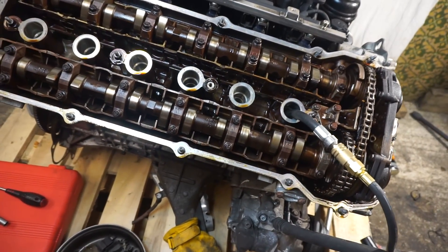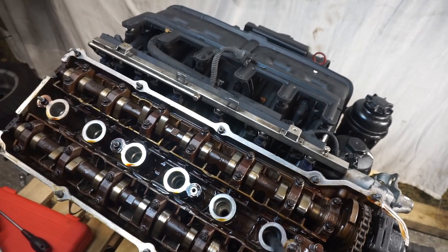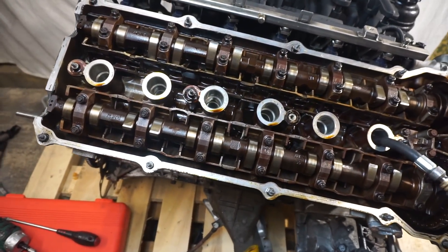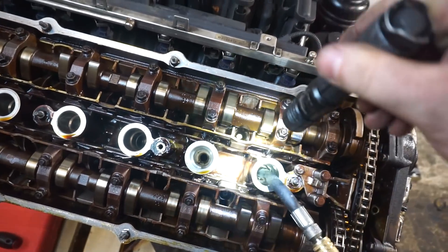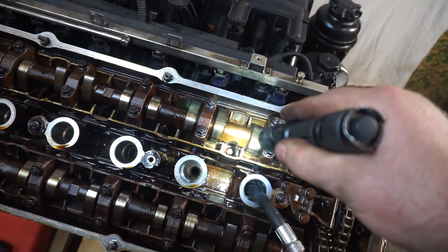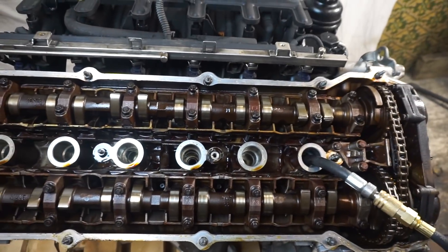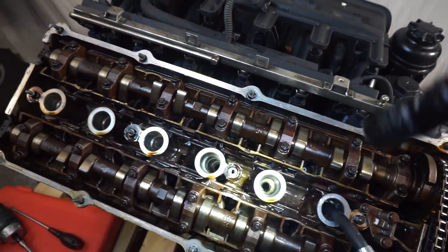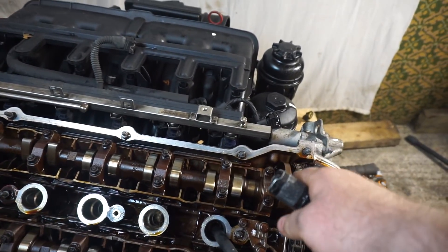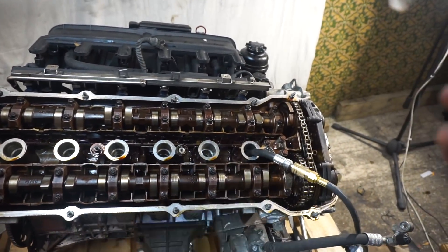How to remove a cylinder head — I did that already on my channel. There's a special procedure for any cylinder head, but mainly when you have an aluminium block and aluminium cylinder head. The aluminium block is the most difficult part in modern engines. What happens is the bolt creates a lot of pressure and tries to pull the threads out. So if you remove that bolt in one go, you're creating a lot of heat, and that heat will cause the thread to get soft. Later when you torque down the cylinder head you might pull the thread out.